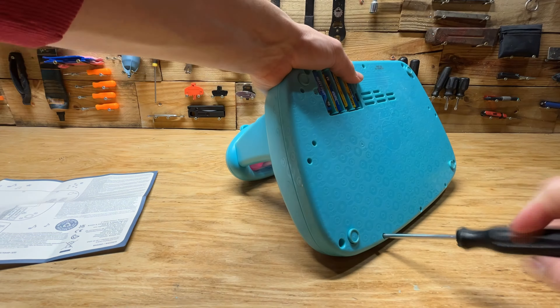All right, so I got this thing opened up and kind of torn into it here. I'm looking at the main control board. There was a little cover on it with three screws I took off. I do see a little bit of corrosion right here. So I'm hoping I can take some vinegar, put it on there, and it'll get rid of that corrosion and everything will start working again. I've got my vinegar over here on a toothbrush — I'll try and zoom in on the area I'm going to be working on.